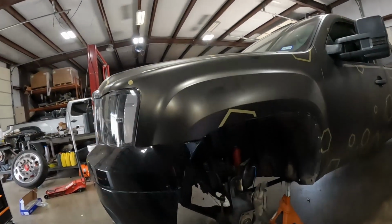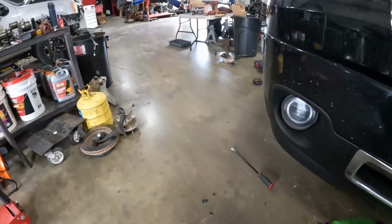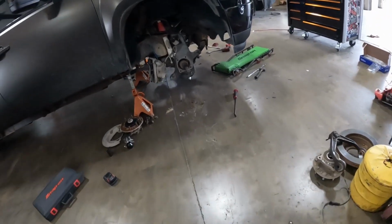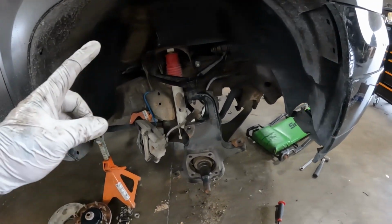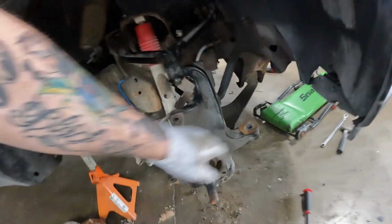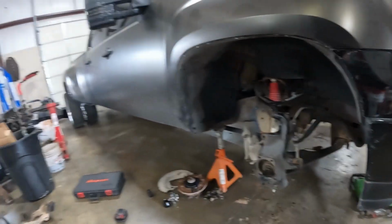We're back. Got our spindles back on, upper control arms, lower ball joints pressed in, idler support, and pitman arm are in. So we're about to toss the center link tie rod assembly back underneath. Actually, I'm going to wait for the tie rod and center link until I get my hubs and brakes and stuff back on. It just makes it easier doing brakes and hubs to be able to actually turn the spindle back and forth. So might time lapse that.